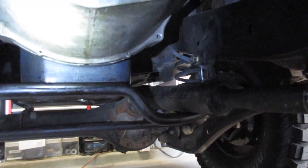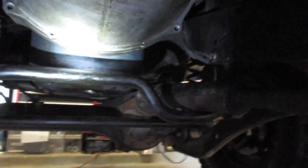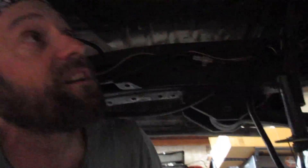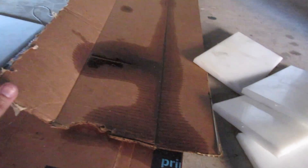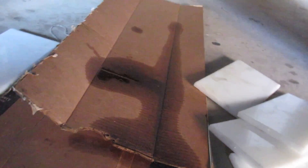Starting to get my flashlight here. Bell housing — I need to take that off, I need to take the clutch off. I took the slave cylinder off already. The only issue I may find here as I crawl under — right there it's leaking. This is what it looks like after the test drive: after I shut it down, once the oil was returning to the pan, it was leaking out the back.